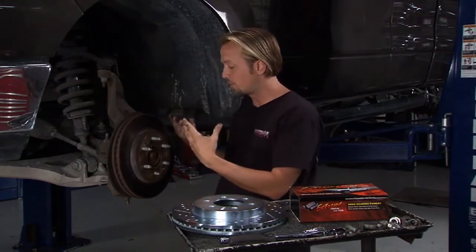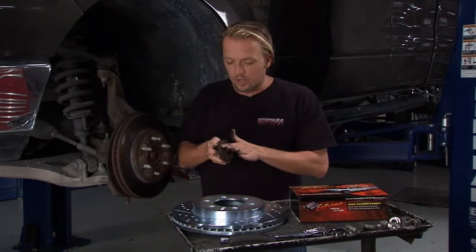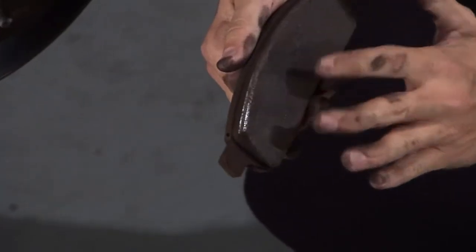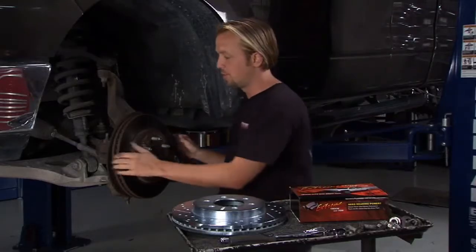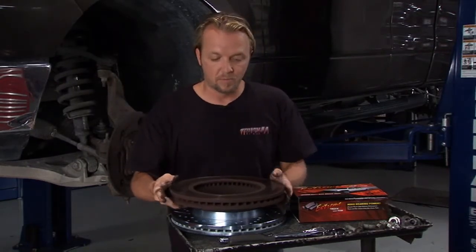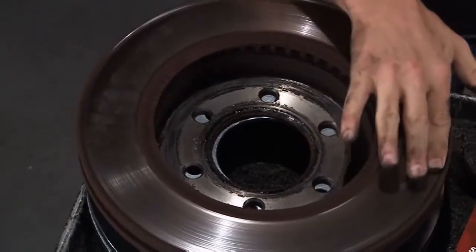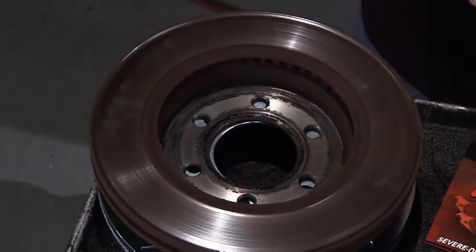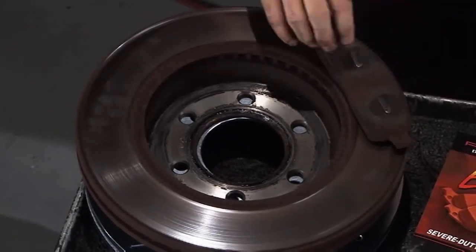But now that we're up here in the front and we're ripping apart the whole existing braking system, we can see what kind of shape it's in. Now this was the pad that was on the back side of the rotor — there's a major, major lip up here and I'm guessing that cut into the rotor pretty good. We can pull this off and get a better look at it. You look at this and that is nasty. I'll bet you can't even probably get this turned. I mean, that is deep, deep, deep cut in there. So there's been some need for new brakes for quite some time — so this is a good day for this guy.